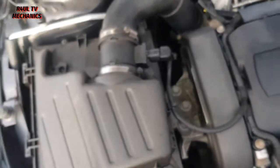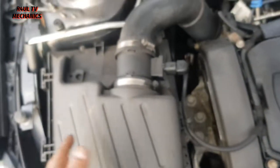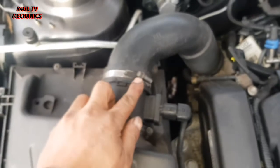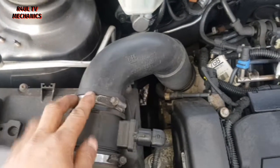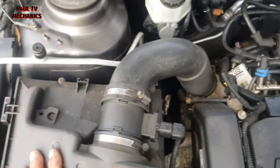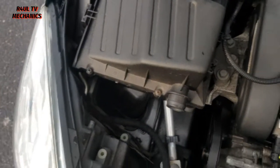To make your life even easier, if you want to go the extra mile, take the air filter box off — it's not a hard thing to take off, but you don't need to. There's a 7mm socket on the jubilee clip — take that off, and basically the air filter box will come off. Take that plug off, air filter box comes off, and you can go ahead and replace it that way.